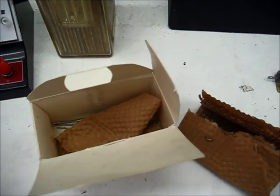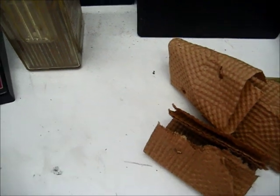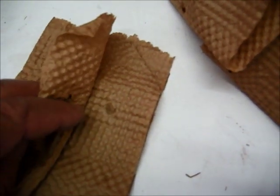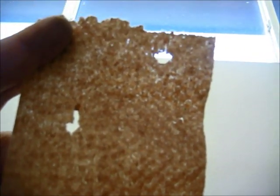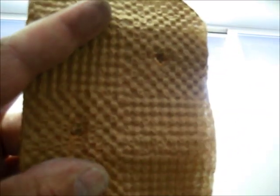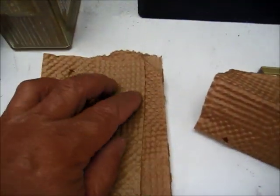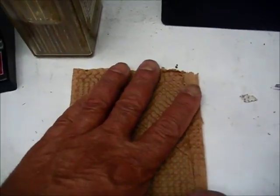So we'll be back. Okay. Now I'm back here. I'm going to point out something to you. In these Dale resistor boxes, this paper wraps up the resistors and they've got it glued together in spots to make a little hole so you don't really want to take it apart. If you hold it to the light, you can see — this is what I mean by porous. But this is just a little bit too porous.